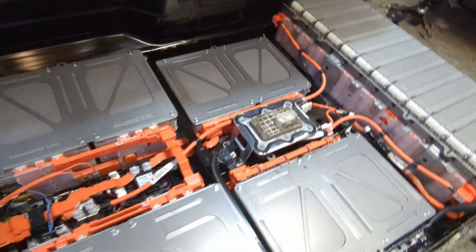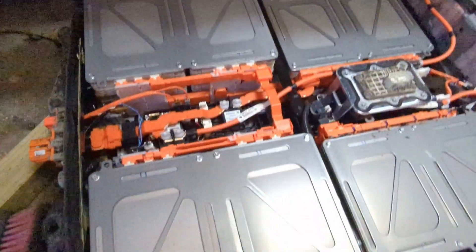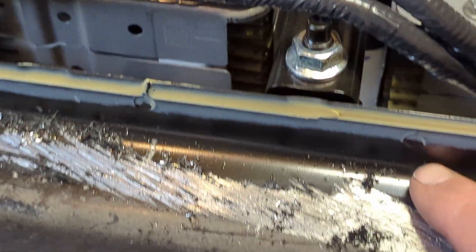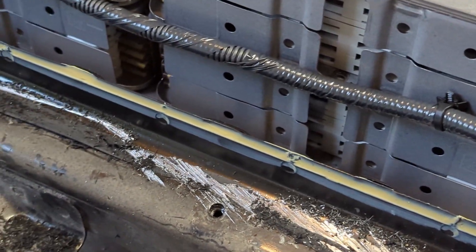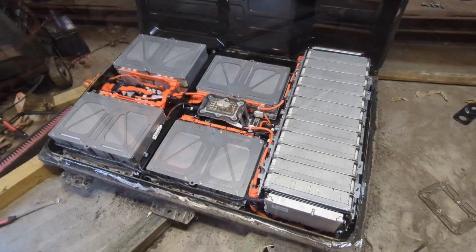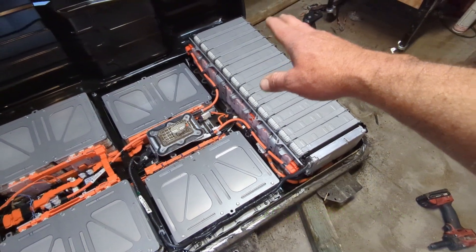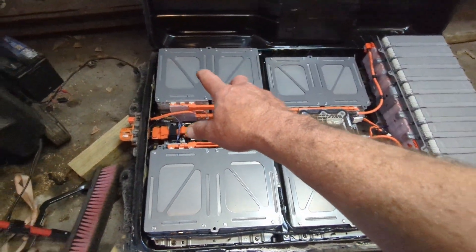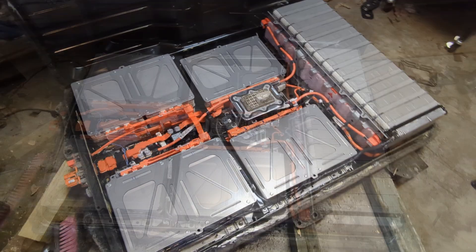I could probably do the fourth side too — that would be the smart thing — but I'm going for it. There's our pack and it's all looking pretty good. Let me get this cover off. Once I got this open, you can see there's actually a lip here, so there really isn't any danger of cutting into the battery. I'm finding out what I have for the first time. I think it's a 40-something. I've got 24 back here — four there, four there — that's 32, plus 4, 4, 8 and 16, so that's 32 plus 16: 48 modules.